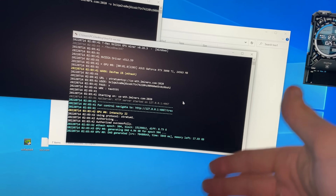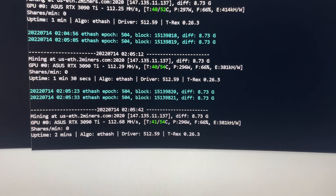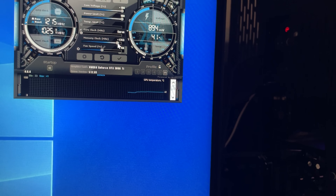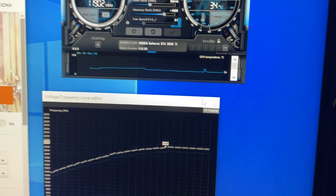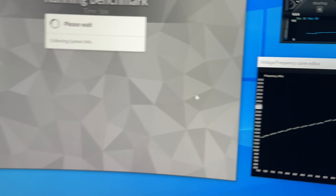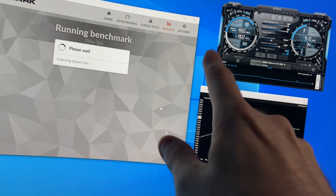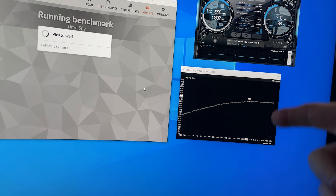I'm not going to warm the radiator up too much, but I want to see — usually when you start the miner, the memory temperatures will go up after like 60 seconds to two minutes. I got the miner up. For Time Spy, let's go with 2235 — just 15 megahertz more than before. Let's see how far this slider will go before it crashes and if we can actually get more clock speed. With the air cooler heat soak it was at 2220 in Afterburner, kind of settling at 2190 after getting to about 65°C. The goal is to see how much more frequency we can get by just keeping this thing cooler.